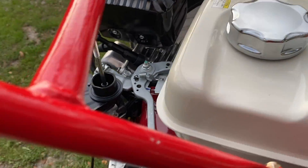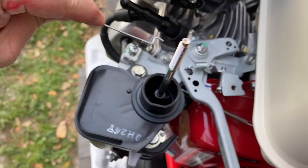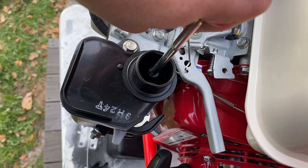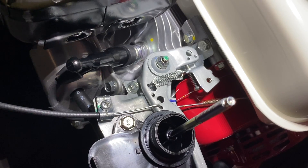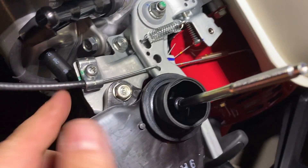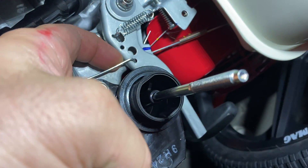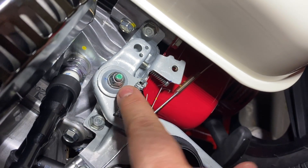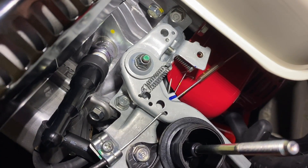Coming back around to the engine, I verified my cable is the correct length, and I've trimmed off the extra. Now all that's left to do is run it through the retainer — you can go that direction or simply drop it in — then hook it up and over. If you've done everything correctly, you'll see the throttle cable is retained right here on the collar using this pinch method. The Z-bend we created goes into the throttle arm right here. It's also worth noting that this little bolt right here — you're going to want to back that off about a half to one full turn, a little bit looser than factory, to allow the throttle cable to operate more smoothly.